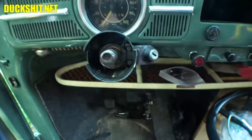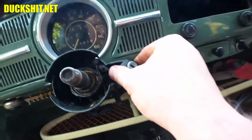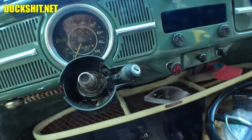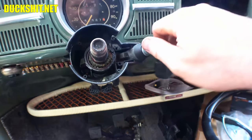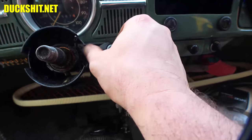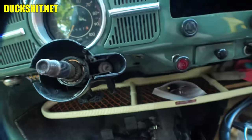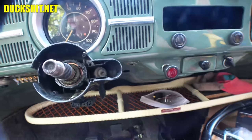Now we've got two screws inside of there. I should pull the cover off the steering lock here. Let's get those out. Those screws are now loose — very gently we should be able to pull this out and take the screws with it. Now this whole steering contraption should come up. You will need the key in it to be able to dislodge it. The battery's still plugged in — disconnect that. To be able to disconnect the column lock, and it should pull straight up and out. Somebody's already been in here because they don't usually come apart that easy. But there's our switch — that's the part we're going to be replacing.